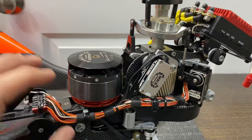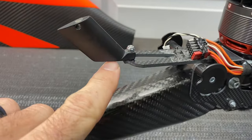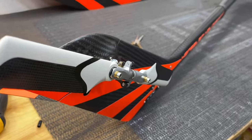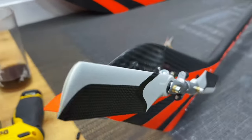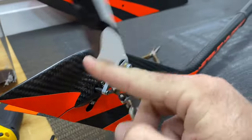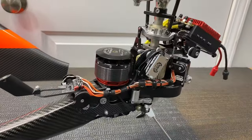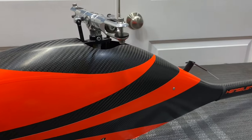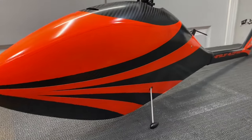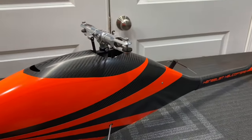This part is all reassembled. We are going to clean up all this wiring, rewire this helicopter, heat shrink it — do the West Hobbies RC way. This is the antenna mount so this goes back just like this. Our V-Bar antennas are going to come through here and out both sides. We got our tail blades on — the X106s, 106 millimeter X Blades. They are not on backwards; the tail rotates clockwise. Let's get the canopy tossed on and see what it looks like.